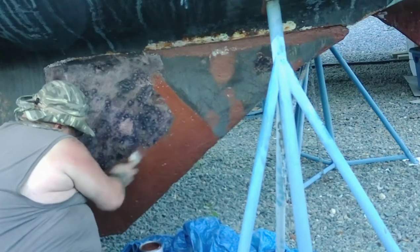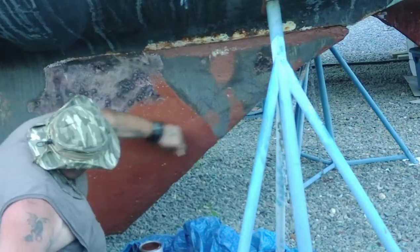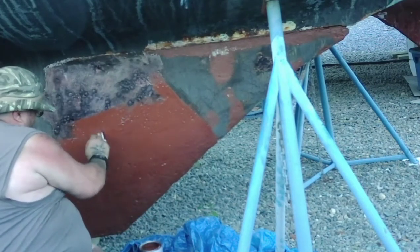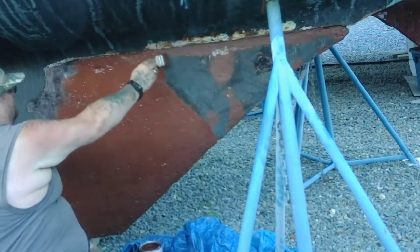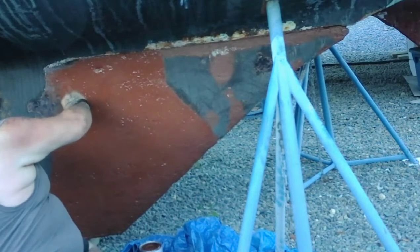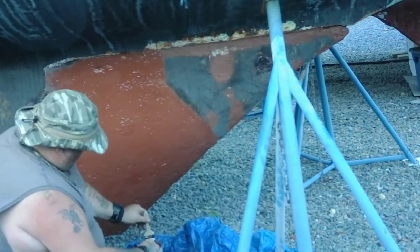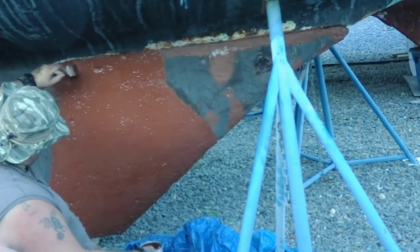When I paint this, you'll notice I don't just brush it on — I also dab and force all the paint into the small areas, along with the rust inhibitor. That way anything hanging around in there will either get cleaned out or get treated and painted, so there's no air gap or raw metal left to be a problem in the future. It's a little odd technique, but it works well for the base layer. Definitely don't want to do it for a top layer though — it will give a horrible finish.